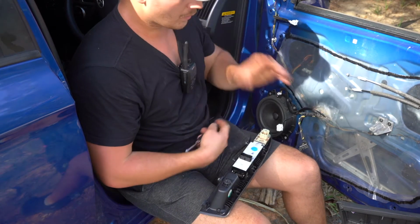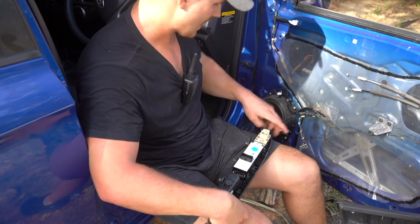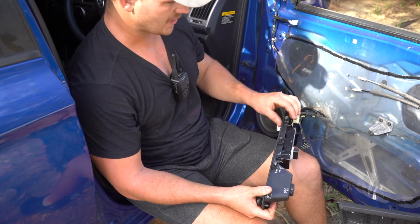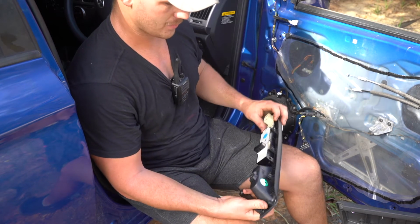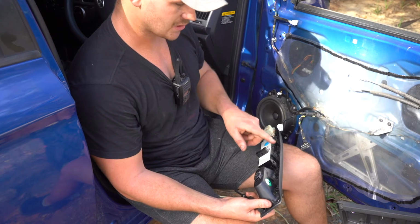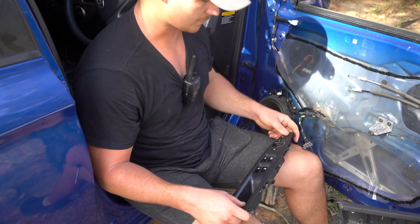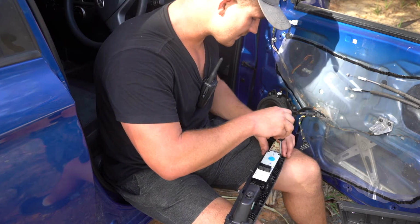Right, what I ended up having to do was actually pull it from the door card itself. Now, it's plastic welded along the edges, but don't worry, when you put this all back in, it'll sit back in firmly, not a problem. You got pressure clips along the side, and you actually have 3 fixing Phillips head screws that'll hold it all in place.